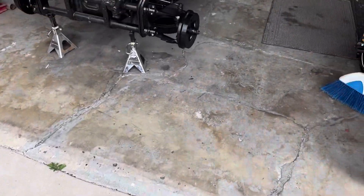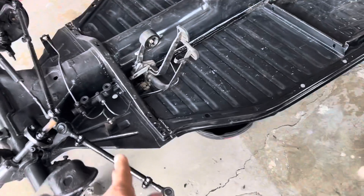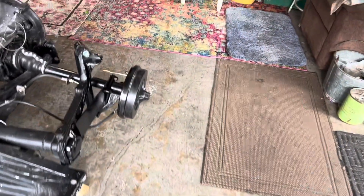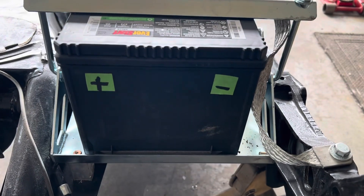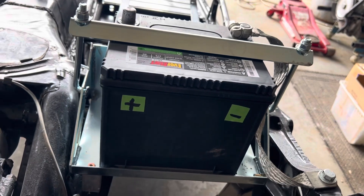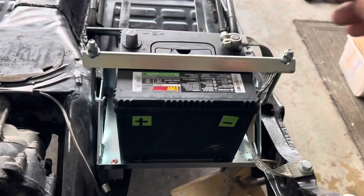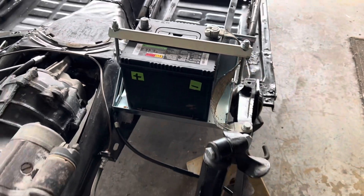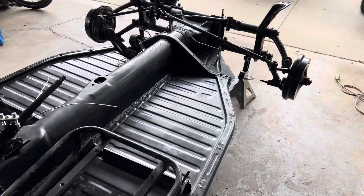That's crazy. I'm just going to zip these bolts off, pull off the backing plate and everything all as one. Without breaking any of the bolts off, pull the whole complete backing plate and everything out. I was lucky enough to have a pair of 66-67 backing plates laying around that are in pretty good shape — just needs a little freshening up. These are, I think, gone. I've got plenty of springs and adjusters and everything laying around, so it's going to be a pretty easy swap over. That's next.